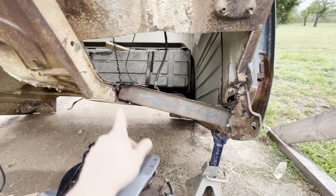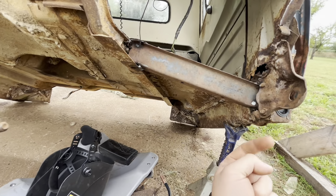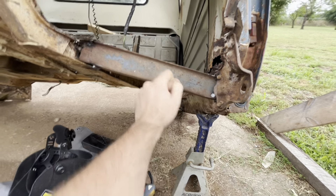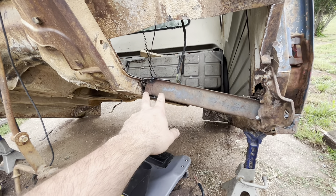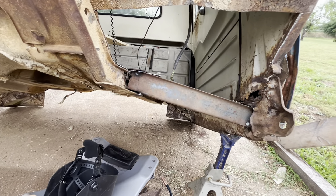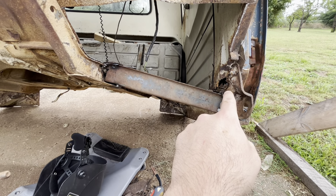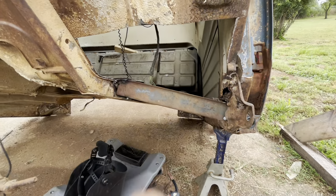All right, need a little bit more work up in there but you can see I've got a few welds over there and welds over here, and I welded on the back side too. So it's not the factory brace but it's got flanges on both sides just like the factory one would, and it's nice strong thick metal. I'll finish up that corner - I might put a little piece of plate in there, clean up with the wire wheel and weld it in. I need to do a little rust repair in this corner but I might do that when I do the floor. Plate there, plate there, floor.